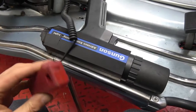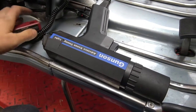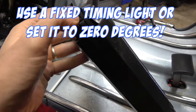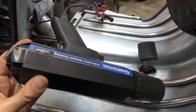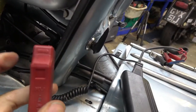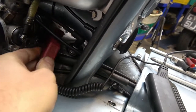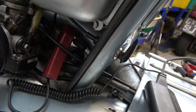This is the final part of the chapter on sorting out your timing. We're going to use a Gunson timing light. This one is adjustable for different amounts of degrees — you don't want that feature because it doesn't work well with scooter ignitions, particularly Varitronic with double spark, so turn that to zero and tape it off. The simpler the timing light, normally the better for this sort of job. There's an arrow on there that indicates the direction towards the spark plug, so I just need to put that clamp onto the HT lead and then we're ready to go.